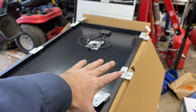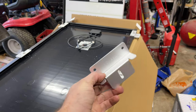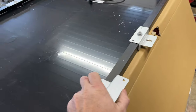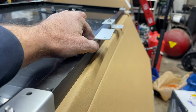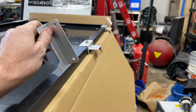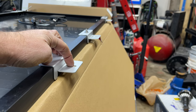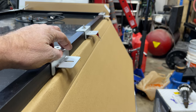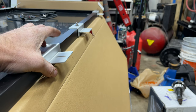Here's the panel ready for the roof. I took the Z-brackets that come with the Renogy panels - they're normally supposed to go one way, but that would raise the panel too far off the roof. So I flipped them around and the unistrut will now run right alongside the panel, which also gives it some protection from branches and sticks since the super strut sits on either side.